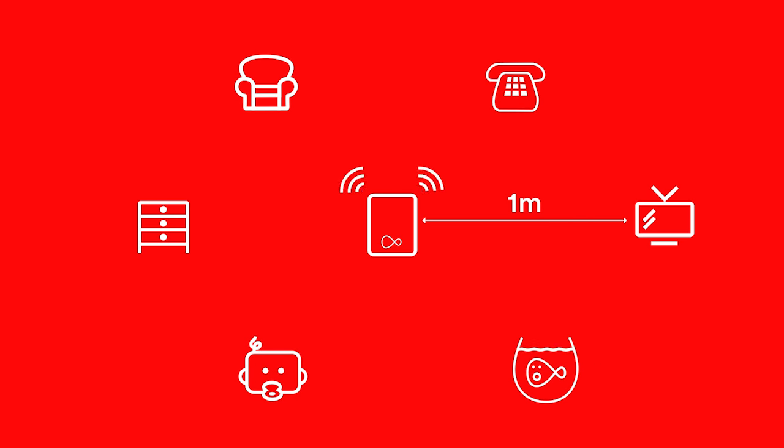When using wireless, you need to think about where the strongest wireless signal comes from. With this Hub, it's best to face the front of the Hub outwards. This device, like all wireless routers, doesn't work well when obstructed. So having it next to large pieces of furniture, fish tanks, or behind the sofa isn't a great idea. Other devices can mess with the signal of your wireless connection — things like cordless phones, baby monitors, and even your next door neighbour's wireless router. So place your Hub at least a metre away from any large object or electrical device.